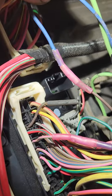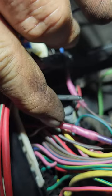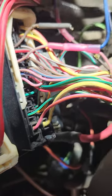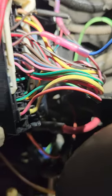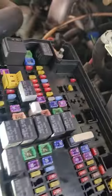You wire it to the relay. Then you come to this pink and green wire right next to it — you don't cut that wire, but you want to splice into it. That will trigger the relay on and off. Then you wire in the fuse link and put your fuse in it. I just stuck it on the main terminal there and done deal.